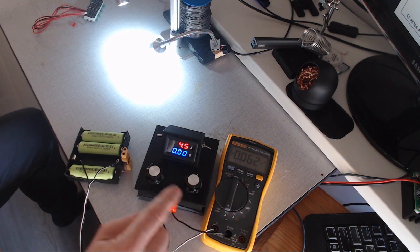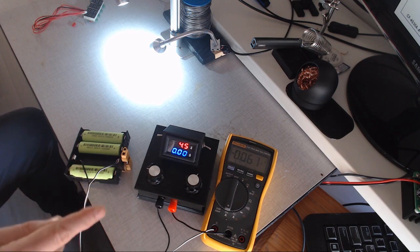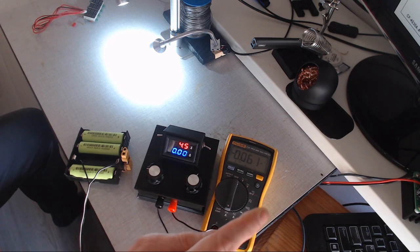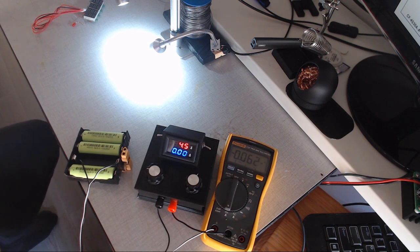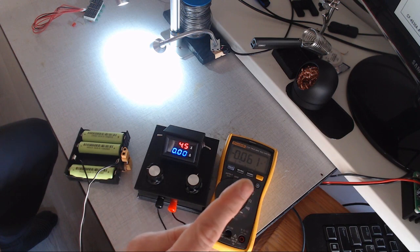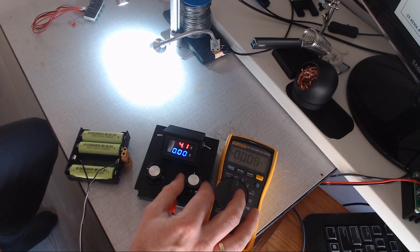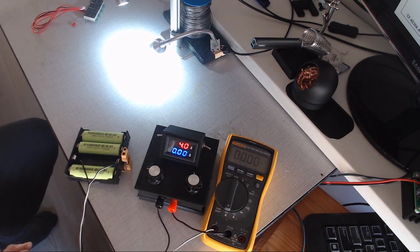You see that? Now the voltage is much too high — the maximum voltage of the 18650 batteries is 4.2 volts, and now this is much too high. So there is a current — the battery management system is drawing a current from this battery, and that current is 60 milliamps. Now I lower the voltage. Look — now the current is gone. So that battery is not draining its energy anymore. It stays stable.